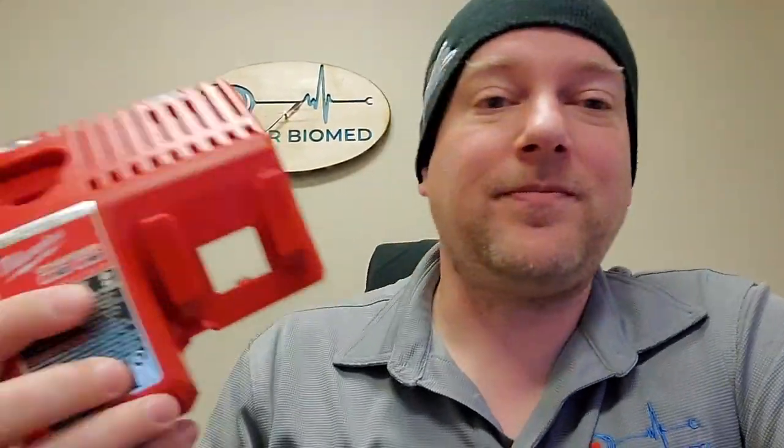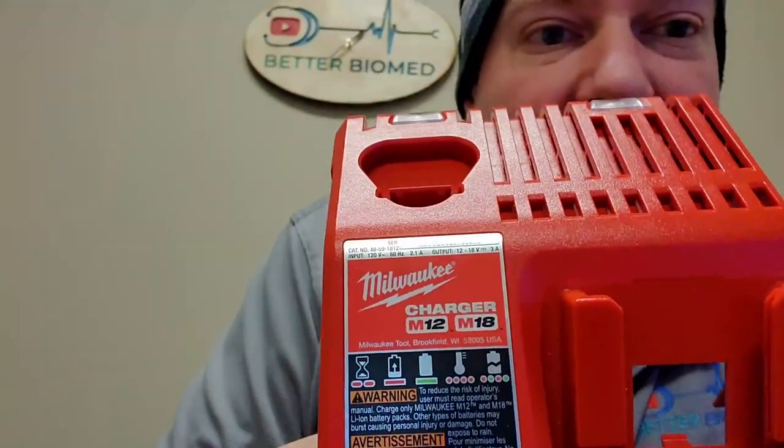If you just ran the battery hard and put it on the charger hot, it's going to sit there and not start charging right away — it has to wait for the cells to cool to a nominal temperature before starting the charge cycle. Likewise, if it senses a rapid heat-up during charging, it will kill the charge cycle, because that means deterioration of the lithium cell — and that means your battery is about ready to explode. The Milwaukee is clearly much smarter and can handle more amps than the DeWalt unit — but it's also a bit more expensive. It has battery monitoring, balance charging, and temperature control. I generally think Milwaukee builds slightly better tools than DeWalt, though I've got both in my inventory. Hope you enjoyed that — thanks for watching.